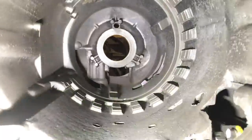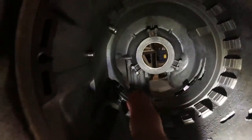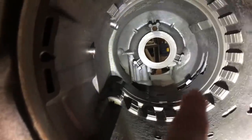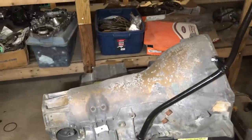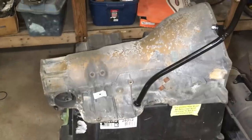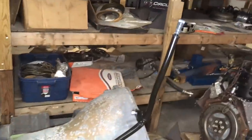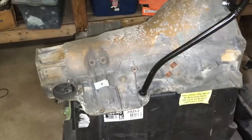Overfilled can be just as bad. More than a quarter inch above the mating surface means fluid comes too far into the main body of the case, which is open down there. The gear train will slosh that fluid and aerate it — putting air into the hydraulic oil. Hydraulic oil doesn't compress, but air will, so it creates a pressure problem and you lose the ability to make proper pressure.